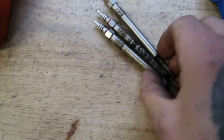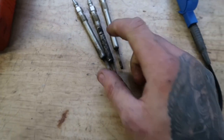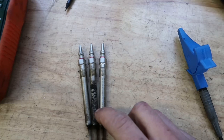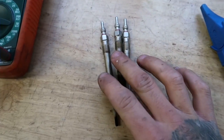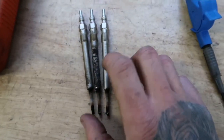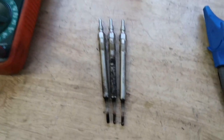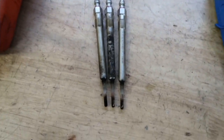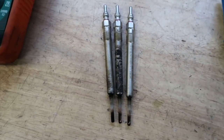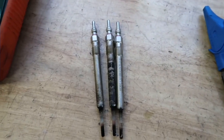The reason it's so important to catch this sort of fault early is not only does it help with cold starts - the glow plug preheats the cylinder so starting will be a lot easier on a compression diesel engine - but also these glow plugs, including the pressure one, are used when the car wants to do a regeneration of its DPF. It heats the engine up to a temperature where it can burn all the crud off the DPF. So really important to catch these early, otherwise you can end up with DPF problems. Thanks for watching.